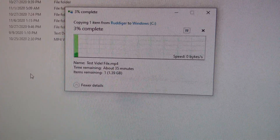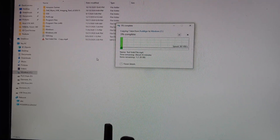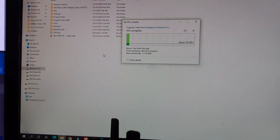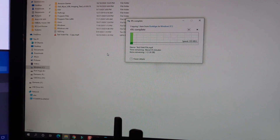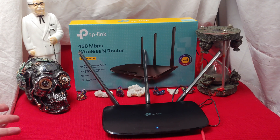Over the local area network, I can still only get about one and a half megabytes per second at best, and it's still a little glitchy — comes and goes. One thing I'll say is the more antennas you have, the better, because dual-band means it can communicate back and forth at the same time. The original secondhand unit probably wouldn't be as good for multiple people as this new TP-Link, because it has more antennas. At this point, I can't really recommend anyone go out and buy a wireless N unless they really don't have the money.